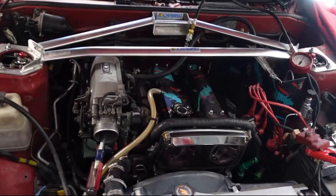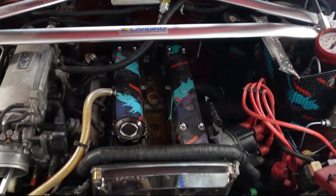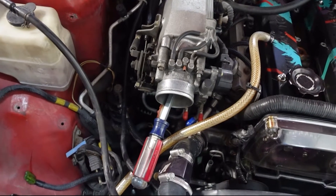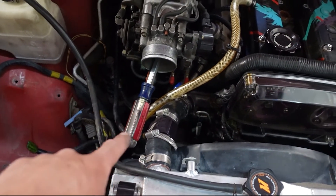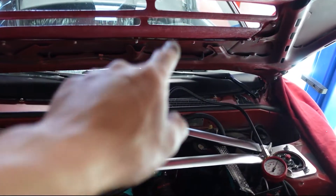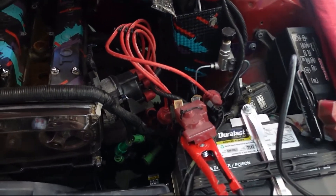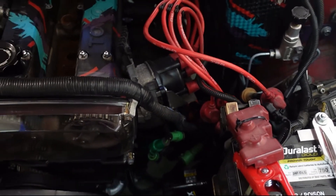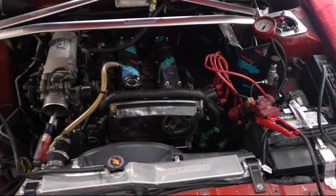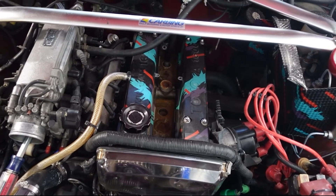That's why you need to do all three tests. Here's our setup. It's good to do the compression test at least a few times on each cylinder. Got my gauge set up inside the spark plug tube. Throttle's got to be held open — I just put a screwdriver to make sure the throttle blade's open. You can also have your assistant hold the pedal down all the way. I have both fuel and ignition disabled — my distributor's unplugged. In the trunk, I have my fuel pump disconnected because you don't want fuel spraying inside, diluting your oil, while you do your compression test.